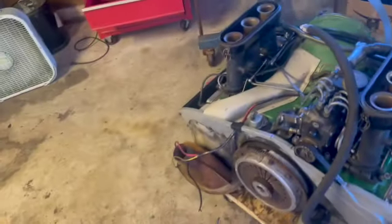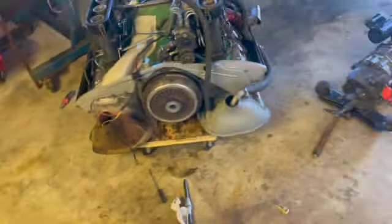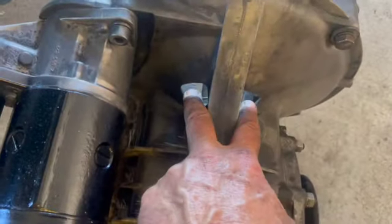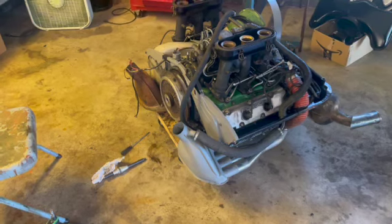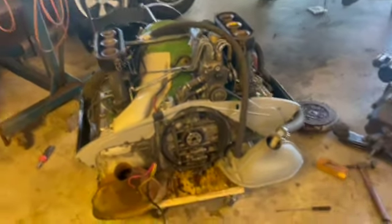All right. 70-71 clutches were not push clutches, they were pull clutches. But Porsche engineering was really good at providing you these nice little windows right here for you to be able to do that. So 14 to 18 pounds, let's just go 15 pounds on torque and clutch.